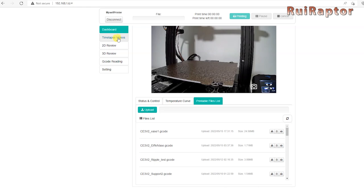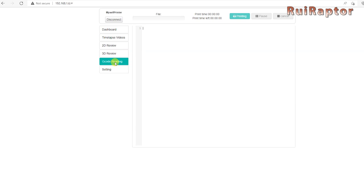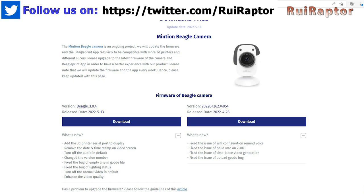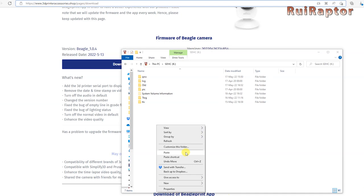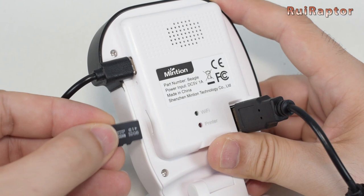On the website, the manufacturer keeps regular firmware updates for the camera, so we recommend updating to the latest version. To update the firmware is very simple — just download the file, copy it to the root of the memory card, insert the memory card in the camera's card slot, and turn the camera on. The camera will then automatically update the firmware.